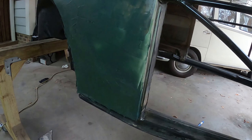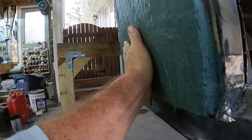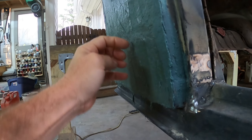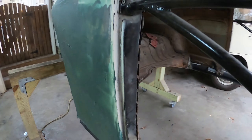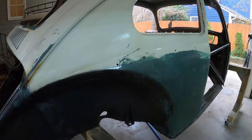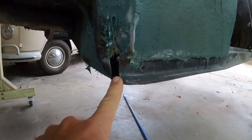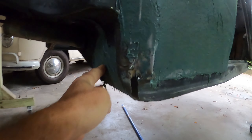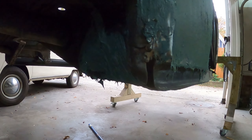Still have to repair this — that's got to be a metal repair. Then this big section here just has a ton of fiberglass smeared onto it, and you can see there's still a little bit of a concave shape. I'll probably sand this down but I've got to add a little bit more right in here. Overall I think it looks pretty good. I need to get a little flap of metal to go over that, and the fiberglass underneath where water will splash up — I think it's fine if it looks a bit funky there.